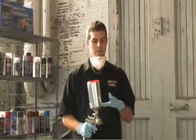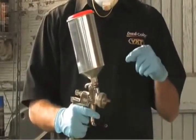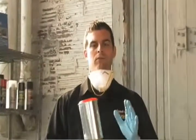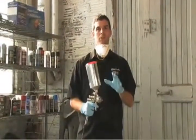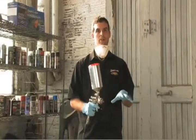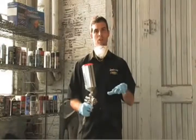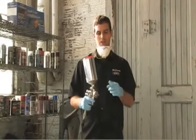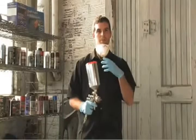We've got our base coat in the gun. We're getting ready to apply it to our primed surface. We are using an HVLP gun — the optimal PSI for an HVLP gun is going to be around 20. If you're using a conventional gun, you're going to want to be around 30. It does vary from gun to gun, so make sure you're testing it on an outside substrate before painting your project. Also, make sure you're painting in a well-ventilated area and using a mask, because especially with this metallic base, there are a lot of metallic particles flying around, so you want to be protected.